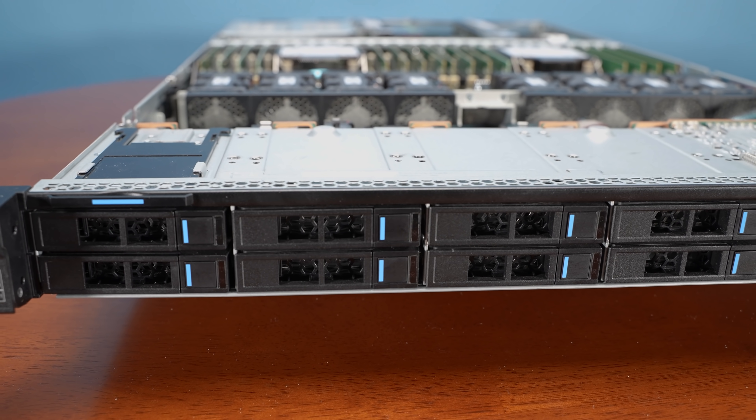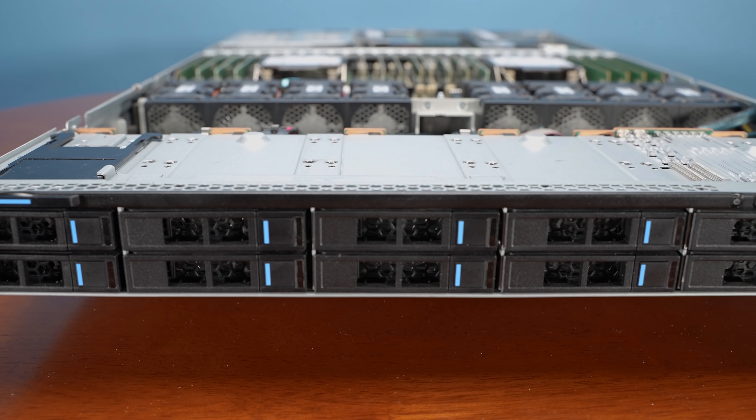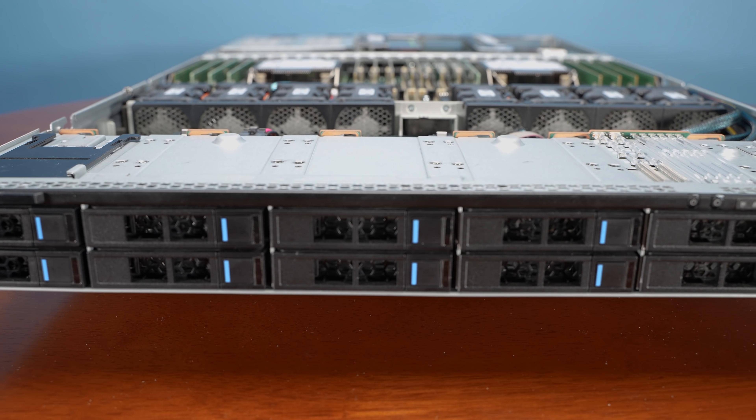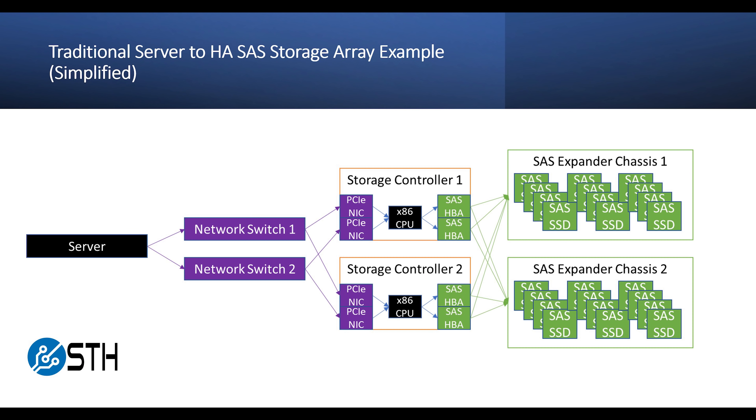For generations, you've had servers with two-and-a-half-inch storage bays. Those storage bays have had SATA, they've had SAS, they've also had NVMe drives. The basic idea is that you take your drives, you put them into the storage server, you have something like a SAS HBA RAID controller, or you just have NVMe connections to the main server. The main server is usually an x86 server with two Intel Xeon CPUs or AMD EPYC CPUs. And then basically, we have to go put that storage onto the network so all of the rest of our infrastructure can talk to it.